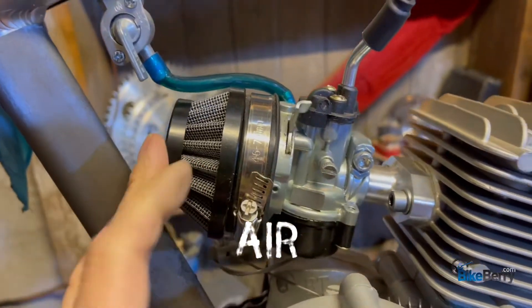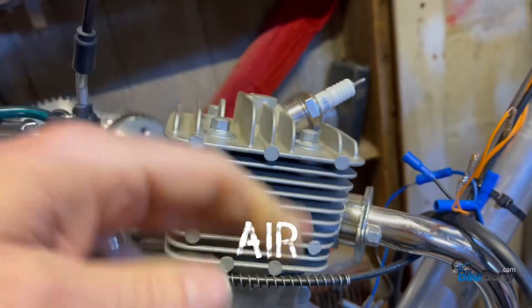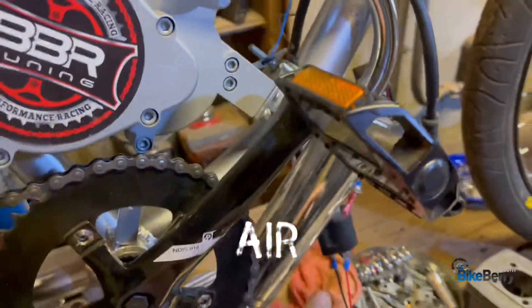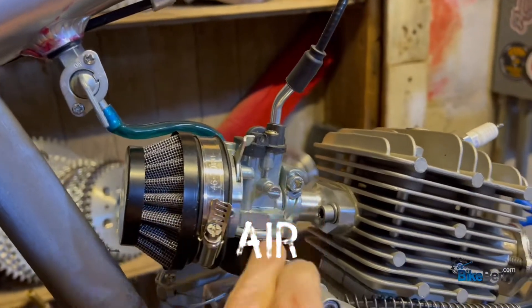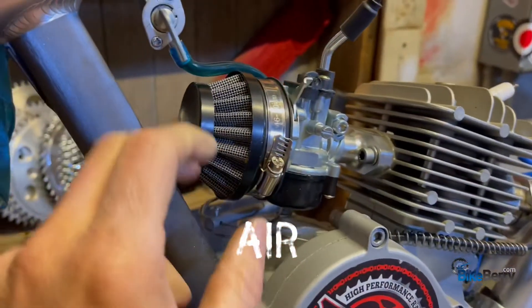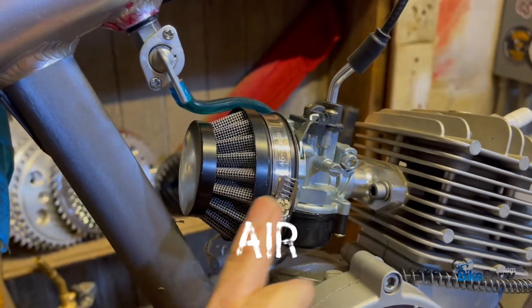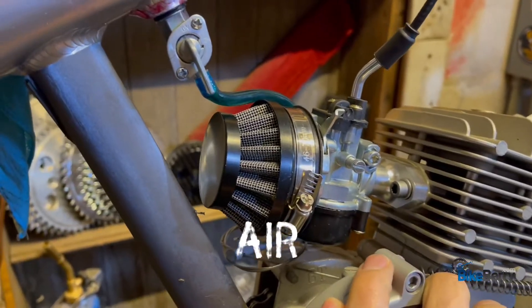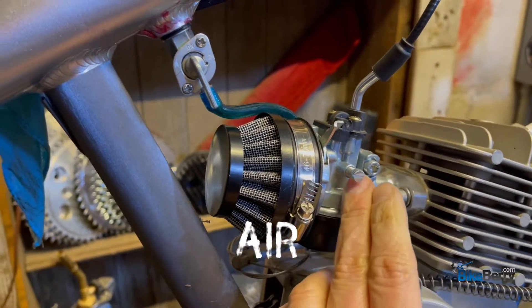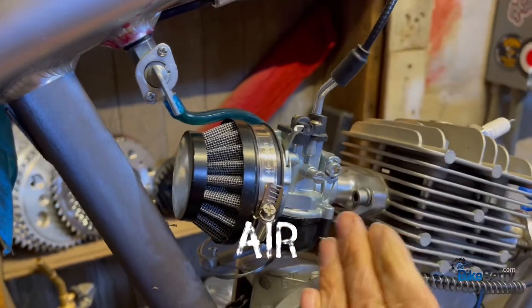The last thing to check is air getting into your engine. Honestly, there's not much that can go wrong here. Air gets sucked in through here, mixes with your fuel, goes in in the right combination, fires, and then goes out. Really, you're thinking: is the slide in here working properly? When you roll your throttle back, is it lifting up and down, opening up enough? A lot of times I run without a cover on here — if you feel like air is the problem, take the cover completely off and see what happens. If your slide isn't working, your throttle's not opening up enough.